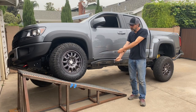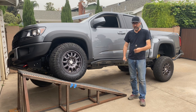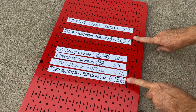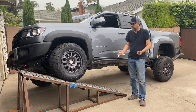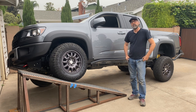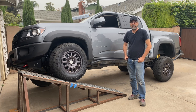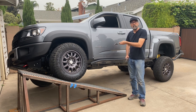So we're at 525 points on the flex index ramp — that's only 24 points more than it was with the stabilizer bar installed. Is it worth it? I don't think it is, for several reasons. First, 24 points just isn't that many — the Gladiator Rubicon was able to gain 149 points just by pushing a button. Second, you have to carry around tools and crawl around in the dirt. And you've got to put them back on when you get back to pavement, because driving with the front stabilizer bar disconnected day in and day out is a recipe for disaster: oversteer, spinning out, loss of control in an emergency maneuver — all of that is a real threat.